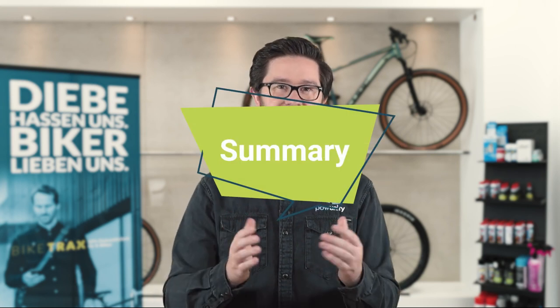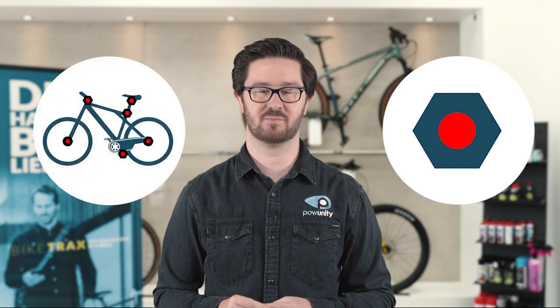To sum it up, an unsecured bicycle saddle is an easy target for thieves, and saddle theft can be quite inconvenient. Therefore, we recommend securing your bicycle saddle against theft. You have several options. You can use an extra bike lock, special nuts and bolts like the pitlock system or a gravity-based theft protection system. Our favorite is the HexLox security system. It's practical and inconspicuous, provides effective theft protection, and can be used for many components on your bike. Just remember to also secure other valuable bicycle parts like wheels and, of course, your bike itself.